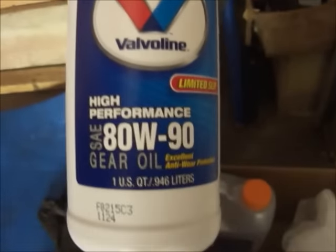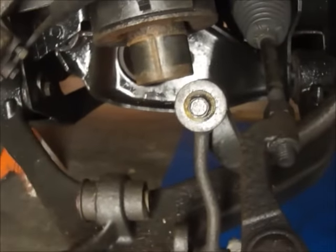There's a drain plug at the bottom. It takes 80-90 weight. I just want to check it for metal filings, but the problem doesn't seem to be from in there — just for peace of mind. There's the plug that comes out of the bottom of the differential. It comes out pretty easy with a number 8 Allen wrench, and I just take that off with the end of a ratchet to fill it back up. It should be just below the level of that when I fill it back up. Luckily there doesn't seem to be any signs of metal fragments in there, so as I suspected, that's okay in there.